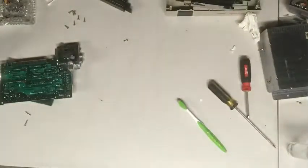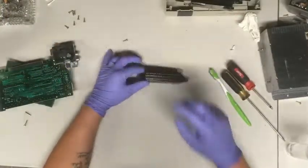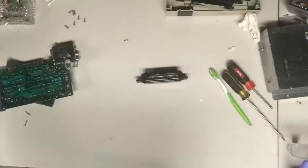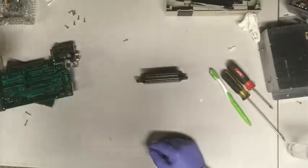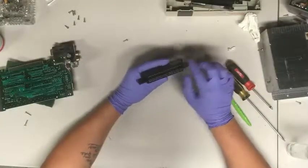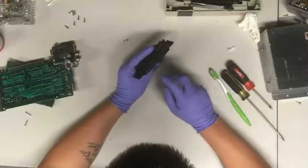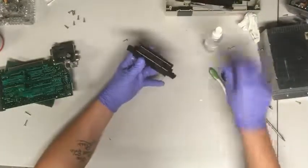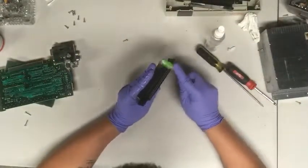After the board is done, you're going to clean the 72-pin connector. The best way is to find a hard plastic card and a good cloth rag — one that won't thread apart and get stuck inside. Spray it down really good with your solution, get it nice and soaked, then scrub away with the toothbrush. Try not to be too rough with it.